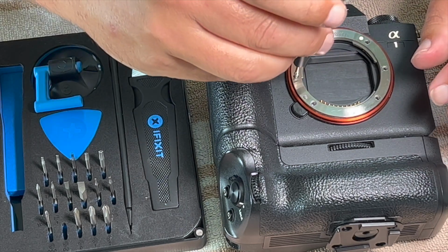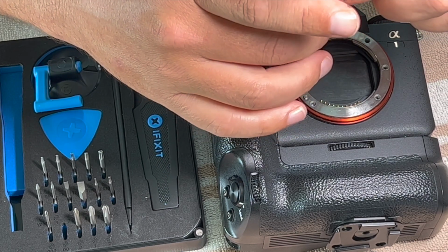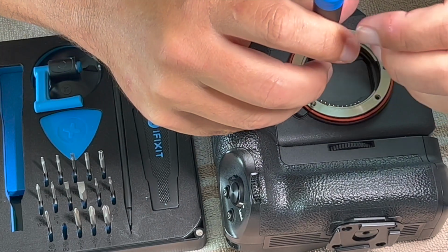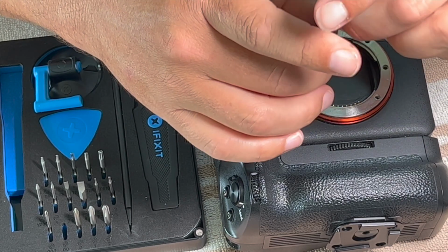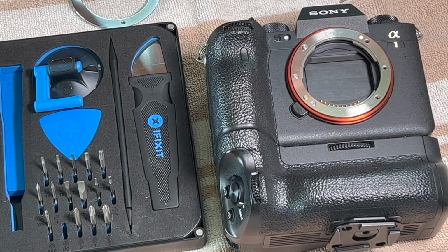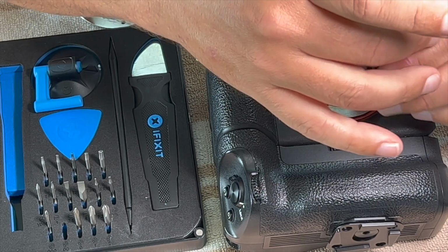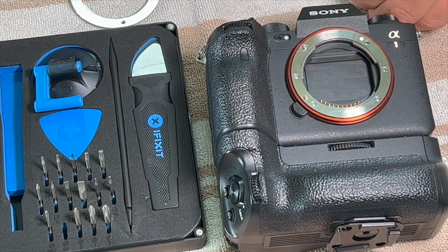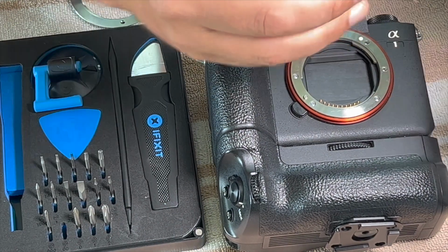And you never tighten all your screws down until you have them all screwed in and put even pressure. So on this, I'm going to go in a circle, even though in some ways when you torque a wheel on a car down or an intake manifold down, you crisscross. But based on these springs and the way this is, I'm going to snug them all in, or not snug them yet. I'm starting them all to make sure that I get all the threads in nicely before I put any pressure on them. Oop, I still almost lost a screw.